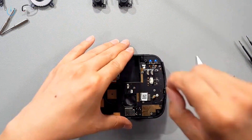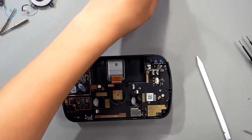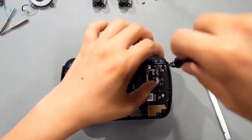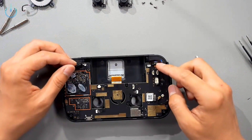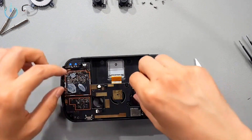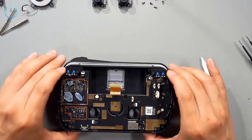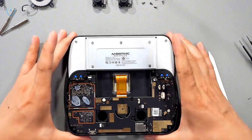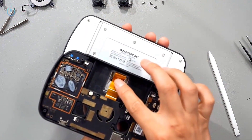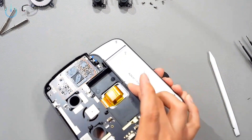There is a Wi-Fi antenna seat here — pry it off. There are relatively more screws on this motherboard. Check to see if all the screws have been removed. We can push this slider to see how the ribbon cable moves inside. This is what the ribbon cable looks like: when there's battery pressure here, it gets pushed down; when it's retracted, it's in a pulled-in state; and as soon as you open it, it gets pushed out.